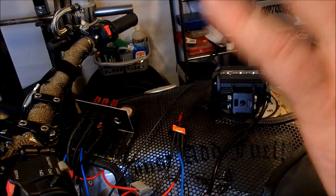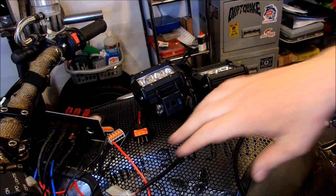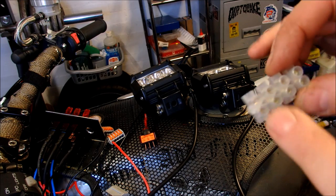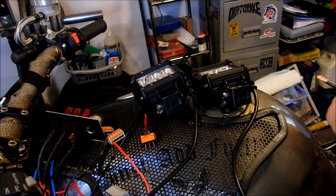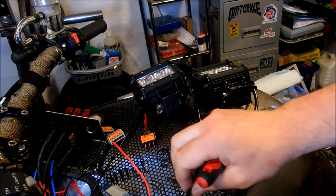So that's one spotlight - how does this change from one spotlight to two? We're going to start again on the basis of two lights. We have two lights, two junction boxes, one switch, my power, and my ground. I'm going to use junction boxes again because they are temporary. Basically I'm going to take both the black wires from each spotlight and combine them.